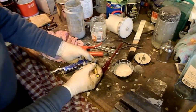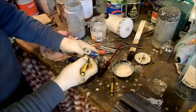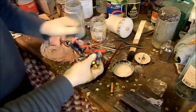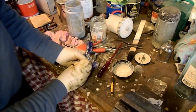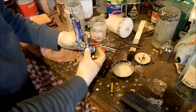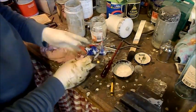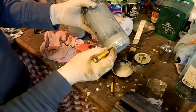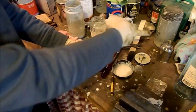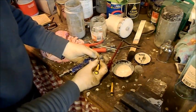Yeah, don't neglect your tools like this, ladies and gentlemen, because if you do, they'll stop working, just like mine have. And this thing, I put a bit of primer in it, and then because I had the paint all mixed in the pot, I just dumped it into the other one, and resumed what I was doing, and then of course it dried. What primer does is it's full of sedimenty type stuff, obviously, and so when you reduce it in the can, when you sort of thin it down in the can, it gets a, well, this is an example, it's in a coffee mug, but you can see all that's just sediment there, that can be chucked out. When it's unreduced, you can stir it up quite easily, but when you thin it out, of course, it all settles and it'll clag your gun up, so you can't leave primer in your gun.